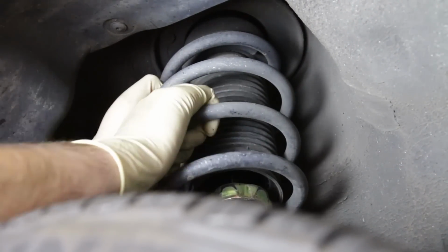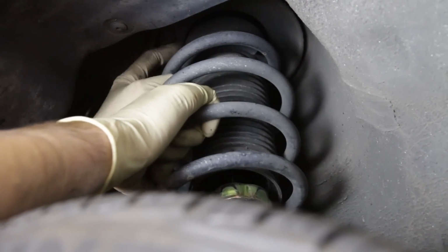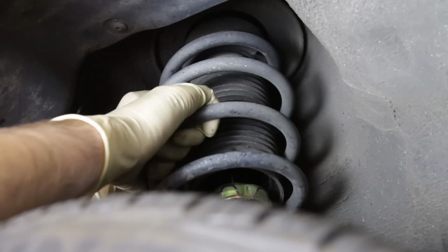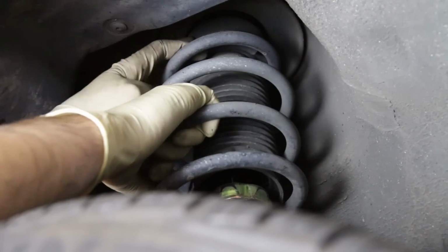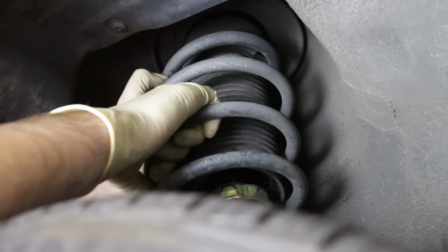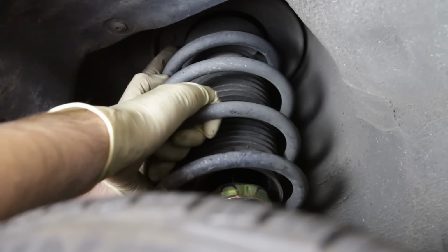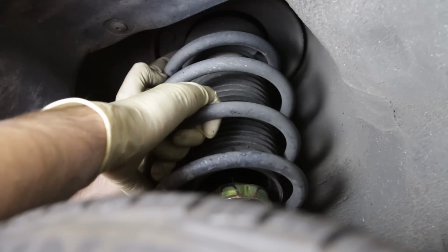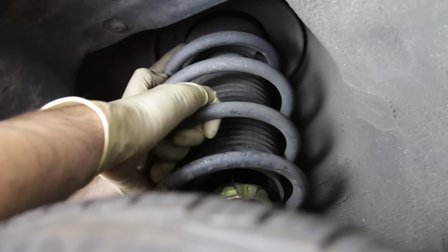And this will happen when you unload the suspension on cars that have kind of loose strut bushing. So this was super common. It always has been. If you ever have suspension noise coming from really most Volkswagen and Audi cars, but specifically ones that have strut mounts, upper bushings and bearings like this, which is pretty much all A chassis cars, you are going to want to look at the bushings and the bearings that are up here.